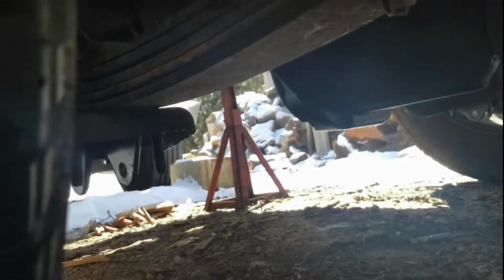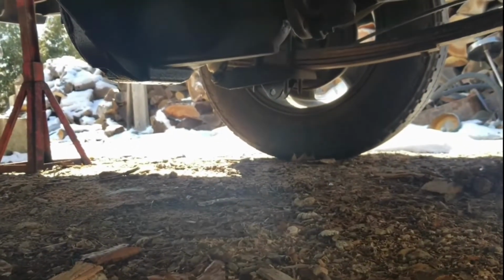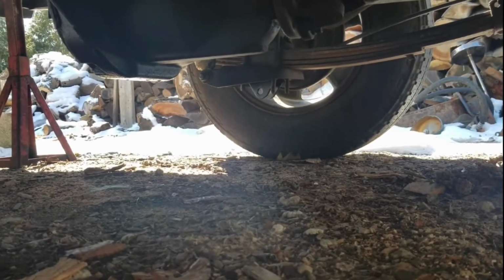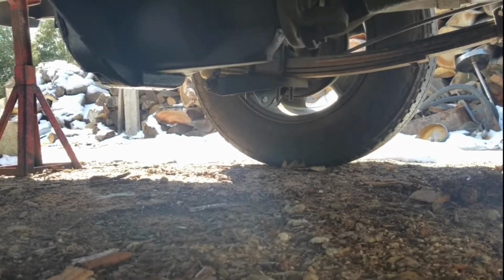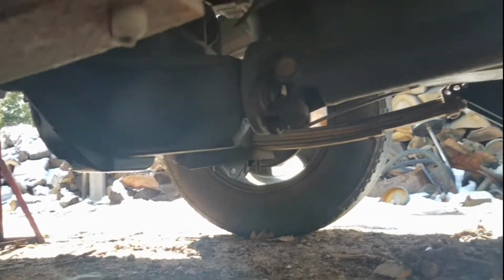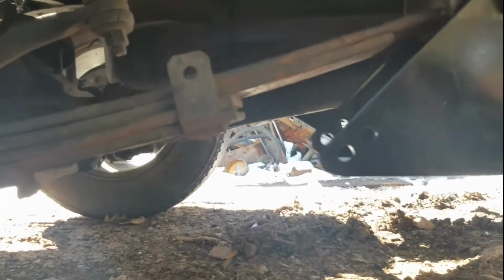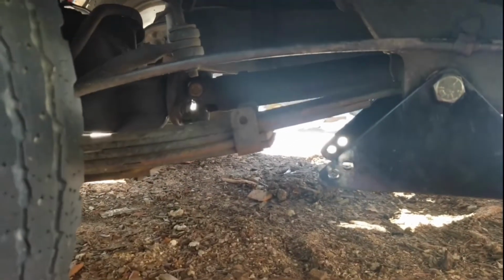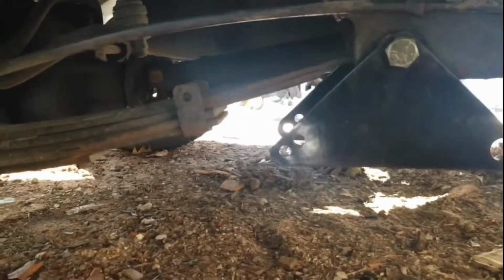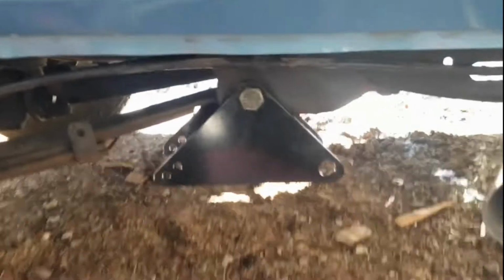So next, I will get it back down on the ground, and then put the bars that I made on the back mounts, and then put them up to the front just loosely, and measure roughly the length that I need. Now the Heim joints are adjustable, so it can be within a 1/4 of an inch, and it'll be just perfectly fine.